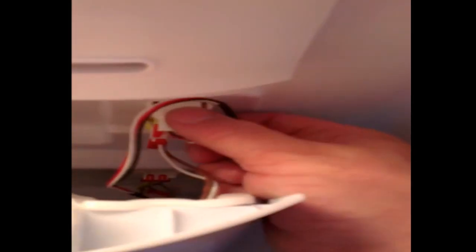At this point it is best to look down the inside of the panel checking for ice. If you can't free the panel away, the best thing to do is to pour hot water down the inside and melt the excess ice. Take care to have a good look down to see there aren't any pipes etc. stuck to the panel before pulling forward. Make sure you unplug the panel connector.